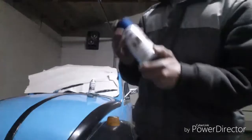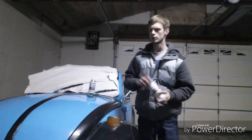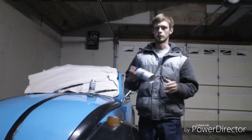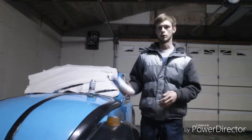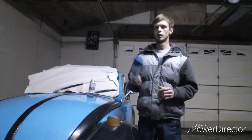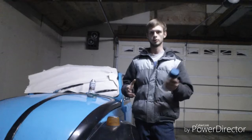If I had better lighting, it's actually a slight shade lighter than what you guys are seeing, but it is currently just past midnight right now. I think it's around 20 to 30 degrees. This is not the weather you're supposed to paint in. I preheated my cans — not in the microwave or anything, just stick them inside, get them fairly warm, come out, spray paint for a little while, bring the cans back in the house, let them warm up, and then you can come back out and continue. The temperature and the humidity are all going to affect the drying time of any paint you use, so I strongly suggest that you read the instructions on the back of your can — it'll tell you the humidity levels and the temperature that you're okay to paint at.